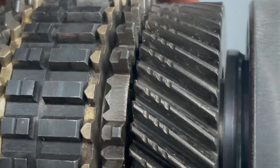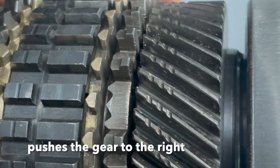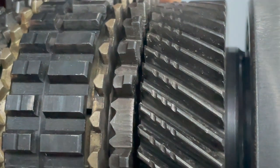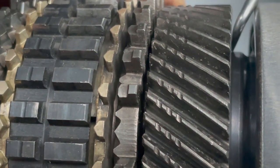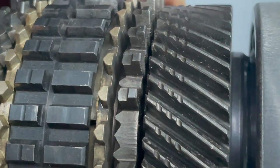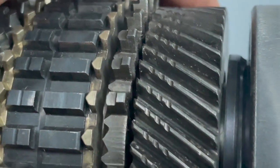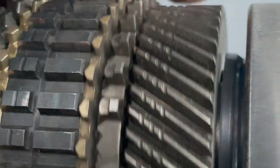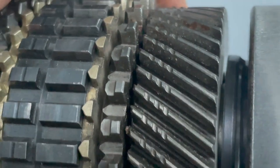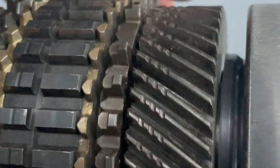When you put your foot on the gas, it pushes this way. And if it stays there for hours and hours, this area here is sealed off and oil can't get in there. But every time you decelerate, it pulls away and oil can get in there. Also, whenever you downshift to third, this gear just floats around in there and oil can get in there.